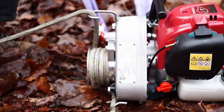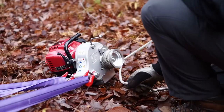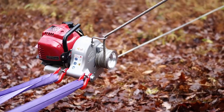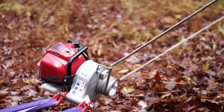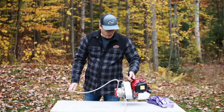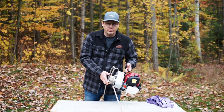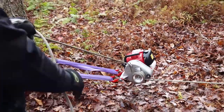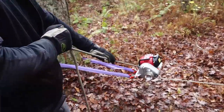Once we're set up, we move backwards and place ourselves — you can go up to three or four feet from the winch. What you want when you're pulling is to have the rope come out horizontally and not above the winch. Because when you use the winch, it's going to want to move. So by applying tension and keeping the whole system under tension while pulling, we keep everything very, very stable.